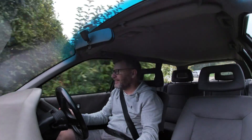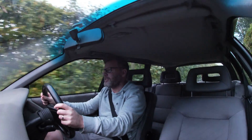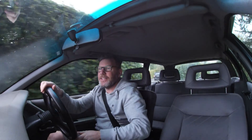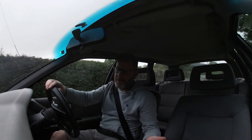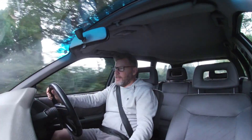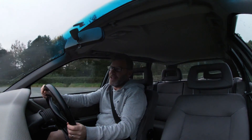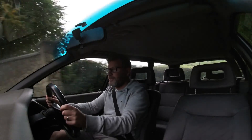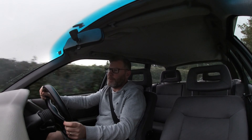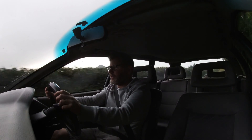So that was that day driving this all day long, charging, charging, charging — it's probably four kilowatt hours here, seven there. We're still plugging away at our estimated state of charge: 372 volts, which is approximately 60%. Trying to get an accurate representation of daily usage is tricky because we live at the top of a hill — fine going down, then coming up sucks the life out of it. Still, working out at about 80km range on this thing.